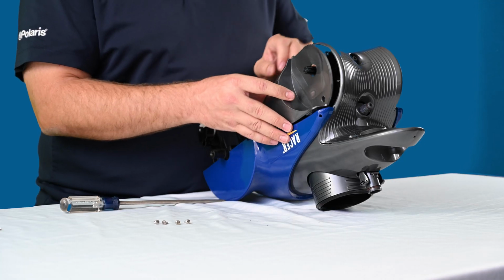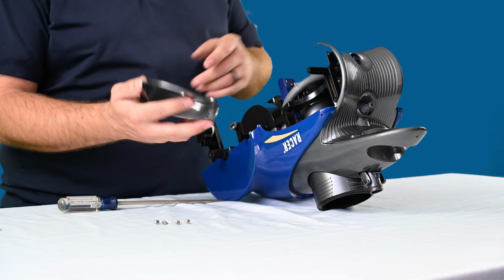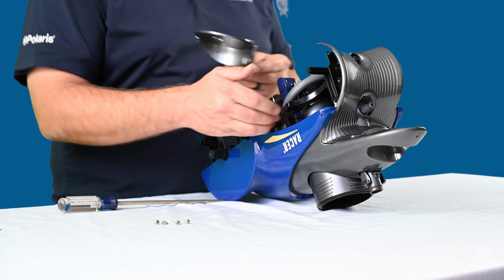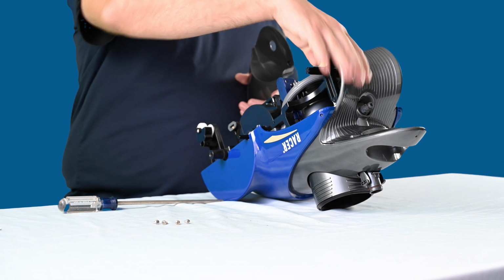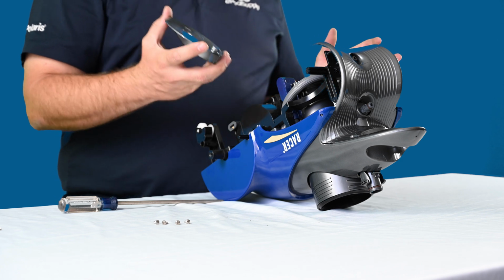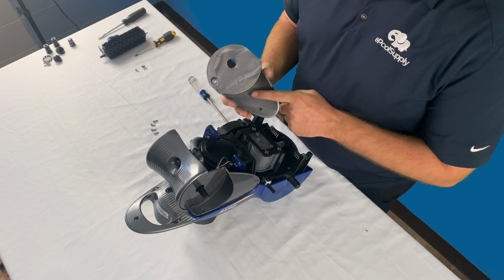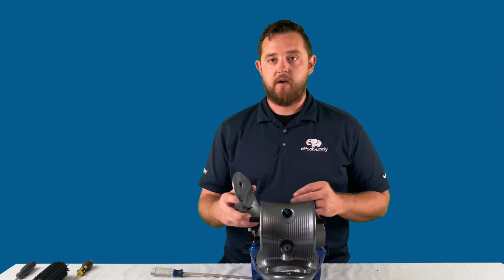It does take a little bit of work to make sure that you pull these off. Don't just yank them. They actually have plastic molds here on the side that feed into a part of the frame. So if it's tucked up underneath the top cover, or stuck here on the rear cover, just wiggle them so that you don't take the chance of snapping these things off. Now, if it's already broken and they've sheared off, do whatever you need to do. But in terms of installing a new one, you want to make sure that you're feeding these tubes back into the frame correctly. That way everything sits, and when you put all the screws in, everything lines up really good.